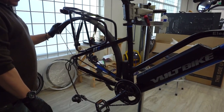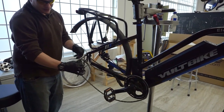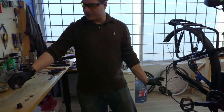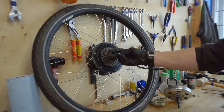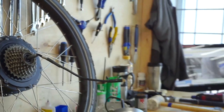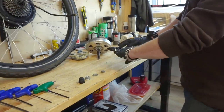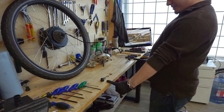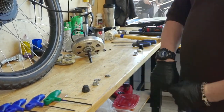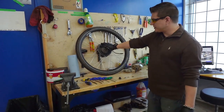For this video I've got a stand here; your home conditions might not be as ideal. I actually like to remove the derailleur from the b-axle and just hang it on the bike out of the way — that will allow the motor to drop out a lot easier. Failing that, you can remove the hardware entirely off the axle so it clears the b-axle on the derailleur. Keep your workspace nice and organized; I put hardware on the bench in the order it was taken off so when replacing them you just reverse the order.